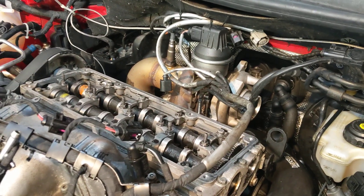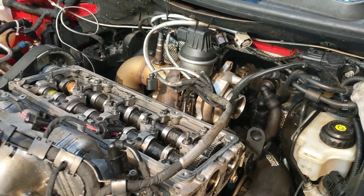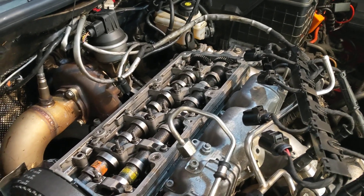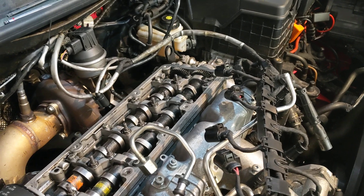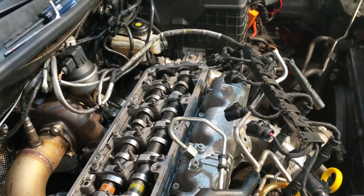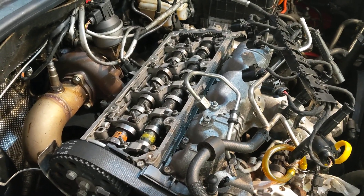Some of you have been helping me sort out the failure with my new camshaft install. It had been running pretty good for maybe 40-60 miles, and on my first attempt to log it and give it a wide open throttle stab, there was a fatal, massive failure. There was a pop at 4,370 RPM and it just quit — it just stopped.